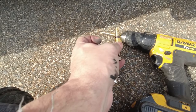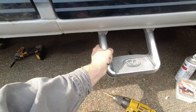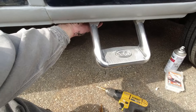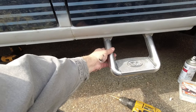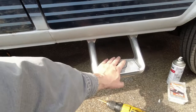I put the four rivnuts in and this is in pretty solid. It feels like it has a little bit of play on this side so I'll go back in and see if I need to tighten stuff up. For the lower holes I drilled straight through. Instead of installing the rivnuts and then re-drilling, I just pulled out the screws and drilled where the screws were for the upper holes. To give myself a little fudge room I drilled the upper holes one size larger than the 5/16ths needed for the bolt, since that upper hole wasn't drilled through the step and into the body simultaneously so it wasn't perfectly aligned. But this is in, nice and solid, these look cool — they're definitely going to make getting in easier.